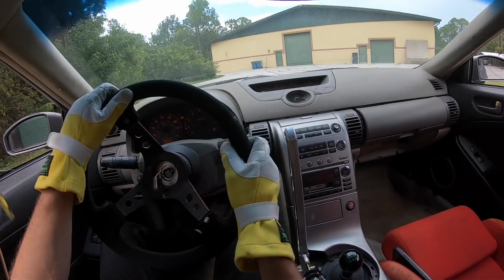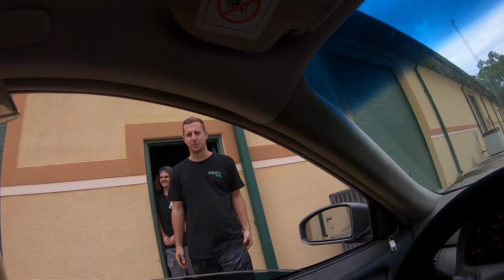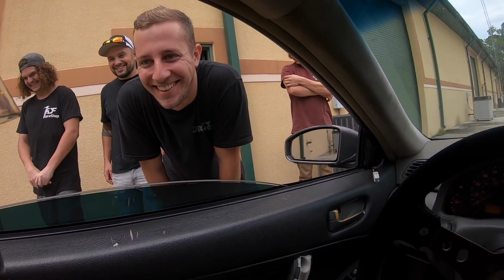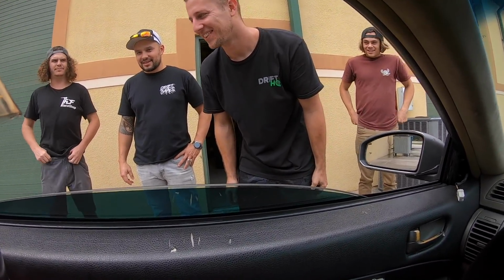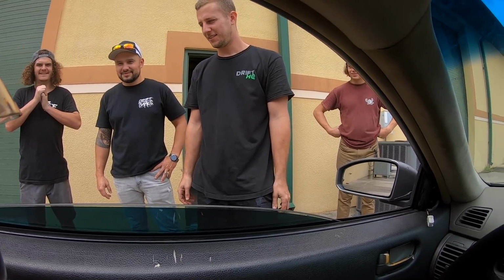I think this thing has a lot of grip in it right now. What tires did you say you put on the rear? I put the GT radials from Pro 2, just the set we had from Schlegel's car. Well, that would explain it. It's grippy, ain't it? It feels like an FD car. Yeah, she bites. I've never had to clutch kick a Z so much in my life. You want us to bump you up? What are they at now? Probably like 18 PSI. That's what Schlegel's running. Bump you to like 35? I would go to like 80.